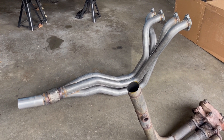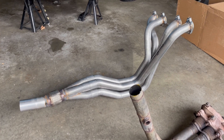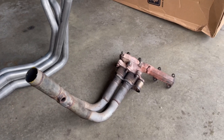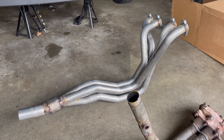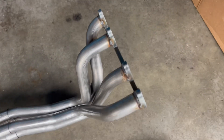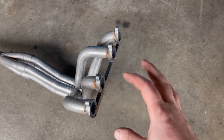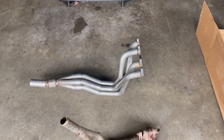Long tube race headers are great for mid to top range power. You're going to want to check your smog regulations in your area because a lot of these are kind of road race only — at least they say that. The old setup was obviously a lot smaller and more restrictive. This TT version is quite robust. In a lot of the cheap headers, they don't have a linking piece, so over time with heat they start to stress, flex, and no longer line up properly. This is a really, really cool piece.